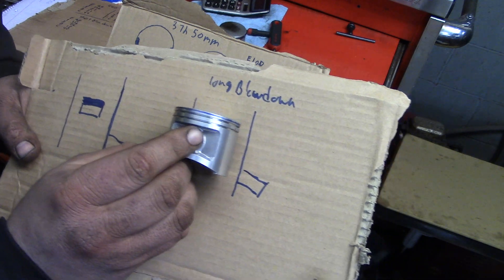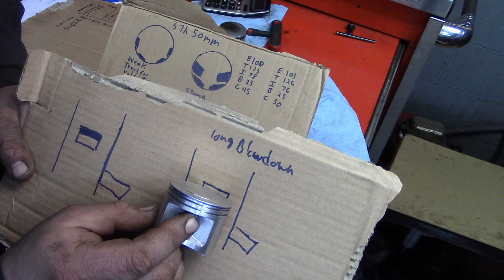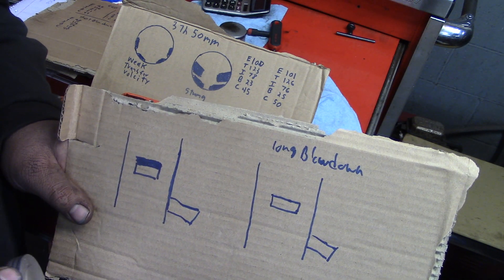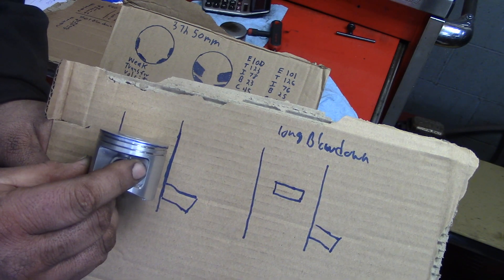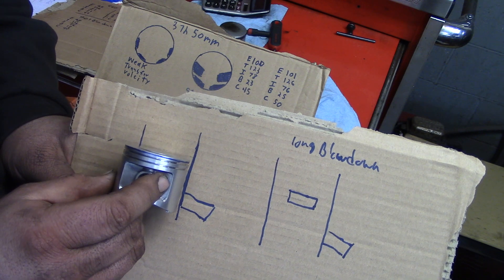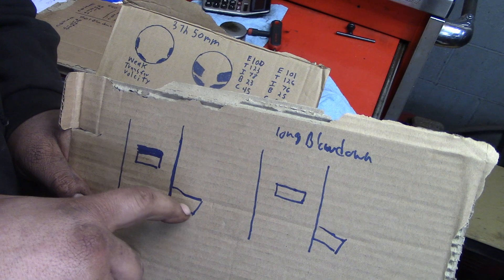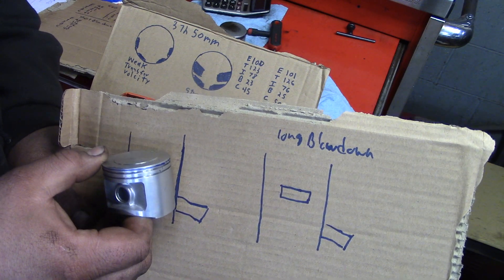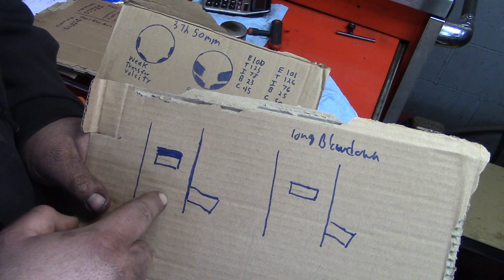It comes down like this. We'll say our intake cracked about right there, coming down here, and our transfer cracked right there. What happens if I raised my transfers — in this shaded area here — is now I only have that much time. When you raise your transfers, you give less time for that piston to come down compressing your crankcase. A way I can help that a little: throw a little JB Weld here so that I bring that piston up just a little bit, giving yourself a little more time to compress the crankcase if you're running a short blowdown, so you'd have a better chance of bringing up your velocity through your transfers.